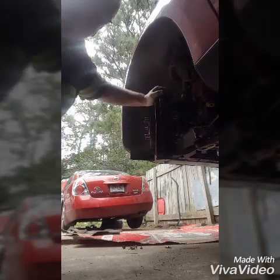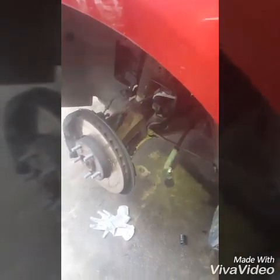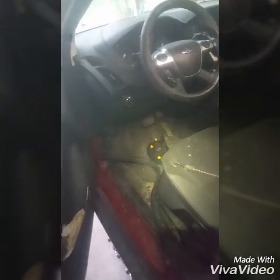It pops out. Now the lower ball joint is just going to be a pinch bolt — sorry it's so dark. You're going to remove this bolt right here, it's about T55 on one end. When you're through disconnecting those three components on this side, you do the same thing on the opposite side. Then the next step is to disconnect the steering column from the rack and pinion itself.